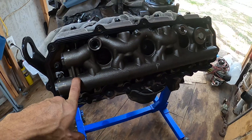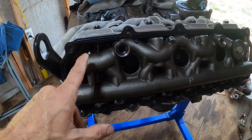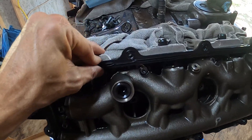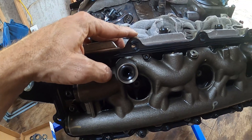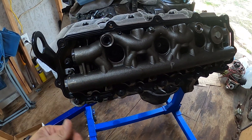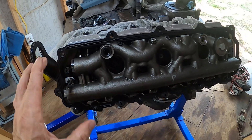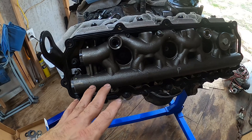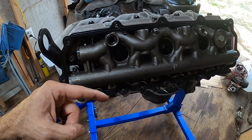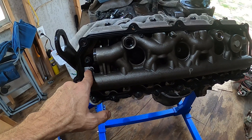I just discovered something that could be very important: the bolts that hold the oil rail down are the same thread size as the valve cover bolts. So if somebody worked on it before you, or if you accidentally stripped it out — because the rocker box is aluminum, it's not that hard to do — there's a link in the description for the helicoil set, and you'll be able to fix the threads for your oil rail bolts too.